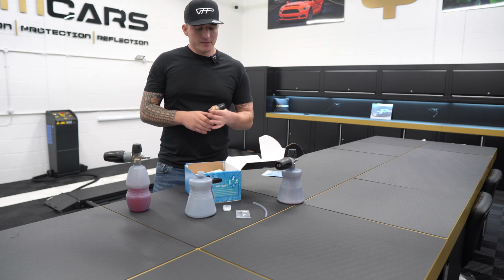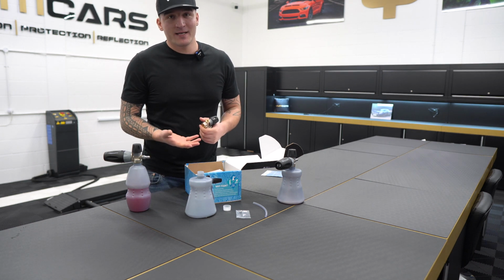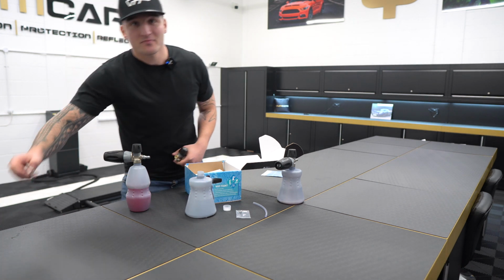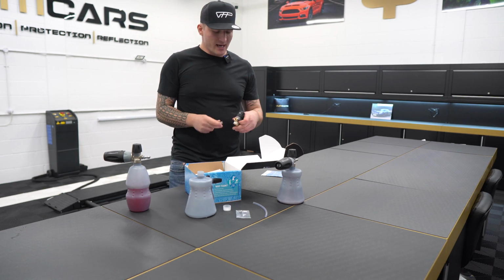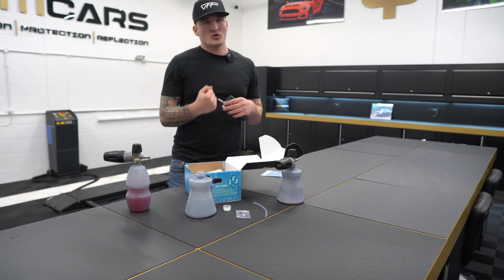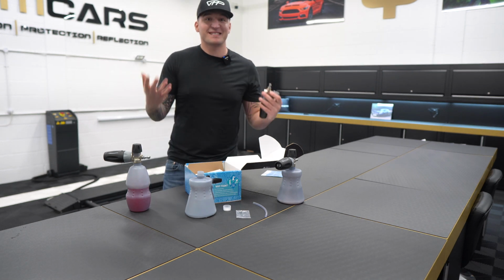So what I would recommend is get yourself 2 spanners, and you do a counter kind of thread screw when you torque it down, and it's nice and easy. It'll take you 30 seconds. So as an example, you've got here an untaped quarter inch disconnect. So imagine this was taped. You would just put this in like so and just torque it down and you're back in business. And as you've seen there, torque it down, it'll take you about 7 seconds.